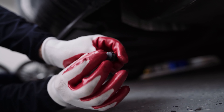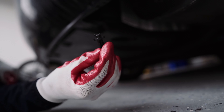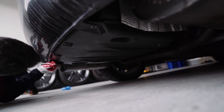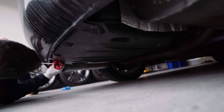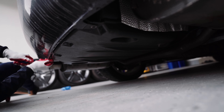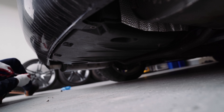At the bottom of the bumper, what you're gonna see now is one, two, three, four clips. This fourth clip looks a little bit damaged on mine, but all we're gonna do is replace or pop out the clips where it's being held from the bumper. It's the furthest left and furthest right clip — left and right — we're gonna go ahead and pop those out.